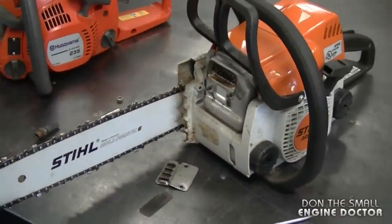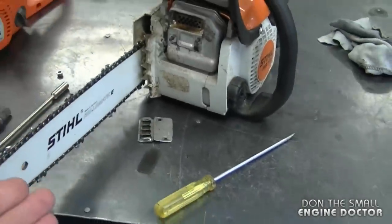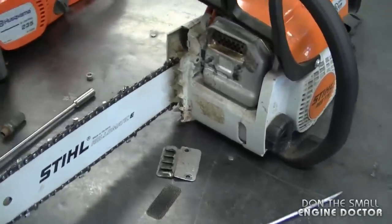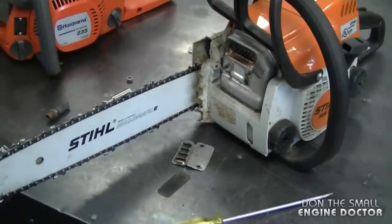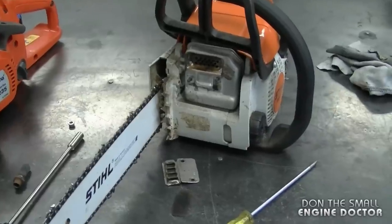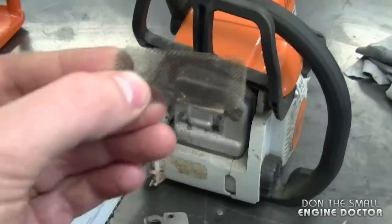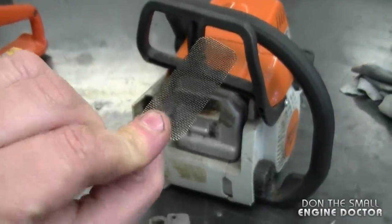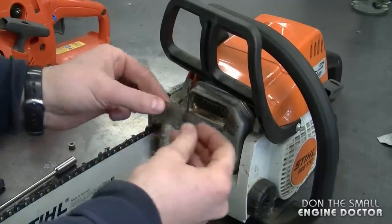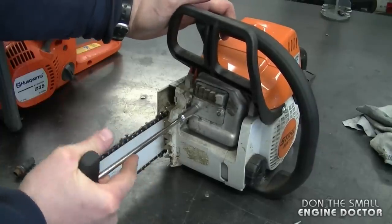Personally, removing the screen is not something I recommend, because if you work around areas prone to catching fire you could easily cause a forest fire — sparks do come out of the muffler. The odds are pretty slim, but it has happened, especially in states like California where it's quite hot and dry. Even where I live, if we get a drought in summer we can get very dry trees or soil and it could cause a forest fire. But again, I get customers so fed up with screens clogging in their MS 170s and Stihl trimmers that they go ahead and remove them.